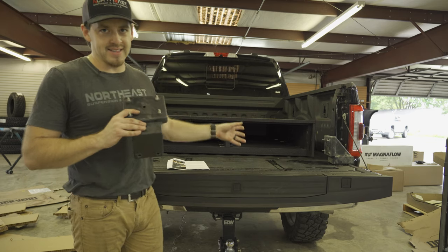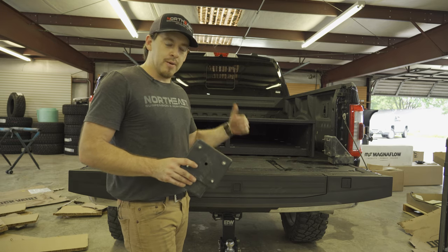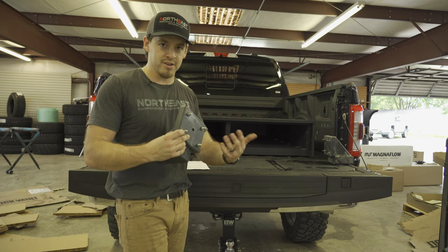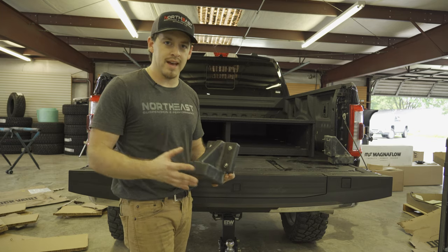Truck Vault's in. Got this thing centered — ended up measuring about five and a quarter on each side. Now we're going to get in the truck bed and put our gussets on. Really important that you put the rubber washer facing towards the Truck Vault, because that's what creates the weather-tight seal so you don't get any rain or moisture coming in from the sides.